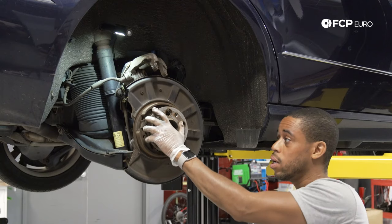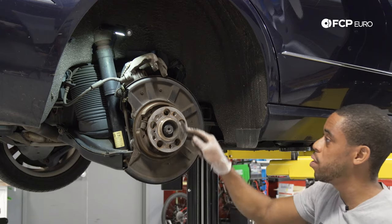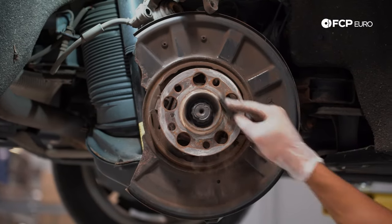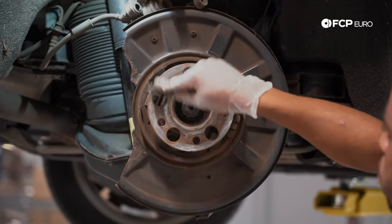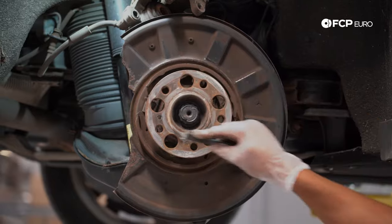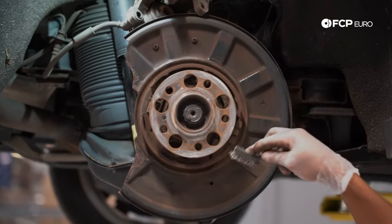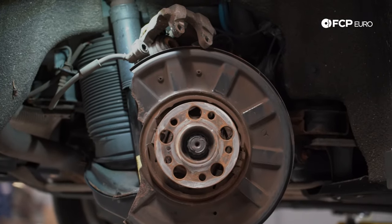This is your wheel hub — your brake rotor sits directly on it. We're going to clean up the hub surface where the wheel sits and also where the rotor sits. A wire wheel on a drill makes very quick work of this; I've got a small brush in my hand that I'll use. The Zimmerman rotors we use have an anti-corrosive coating, so you won't end up with a large amount of rust buildup as a result. The rotors aren't going to stick to the hub surface like an uncoated rotor would. We're cleaning this surface to aid in installing and removing the wheel in the future — you can even apply anti-seize on these surfaces after cleaning.